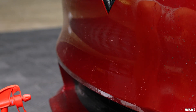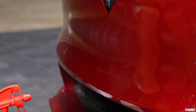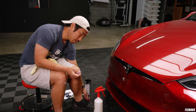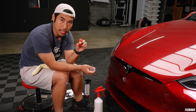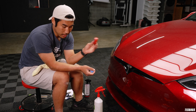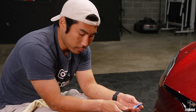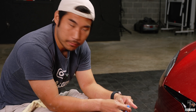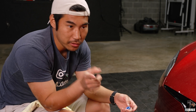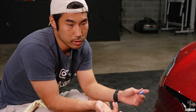Once the clay bar process is done, rinse it and now you can lay film on top of it — you're good to go. Can you put this back on? Absolutely. All you have to do is clean the license plate bracket and use a 3M adhesive like this. Lay it where you saw it and stick it on. It already has that curvature and it will work really well. Can you put it over PPF? Yes, absolutely. If you want to reuse it, you can. Just keep in mind this is an insanely strong adhesive — there's a high chance, especially for wraps, actually 100% chance on wraps, that it will damage the wrap when you remove it. So be very careful about that.